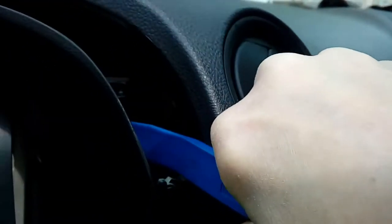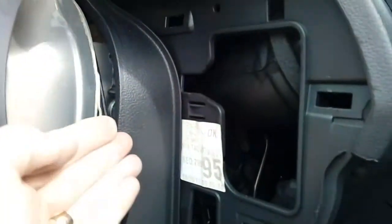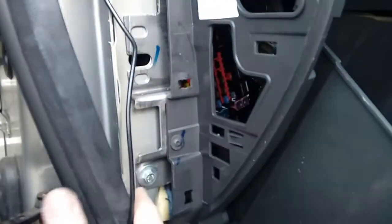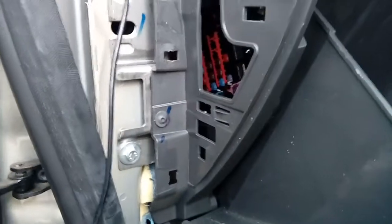Tuck it in nice and neat around the corner. Next, open the glove box because the fuse box is right behind it. Pop this panel off — use the plastic leverage tool and work it around the clips all the way around. This one's very tight as it's never been off before. Pop the whole panel off. Then remove this plastic panel, which is also on clips — pop it off forwards. This gives nice clear access to a 10mm nut, which we'll use as an earthing point.